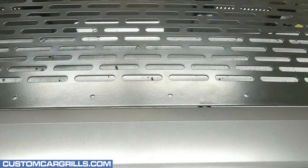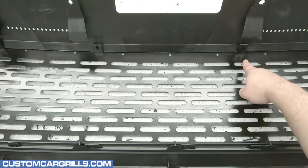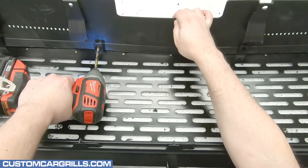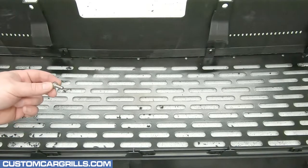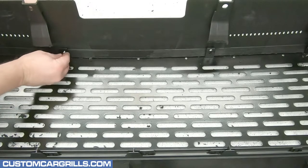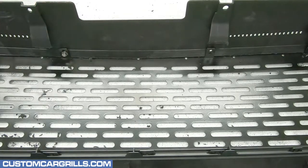Next, it's time to look at the gap on the lower edge, and this should be fairly tight. Then some drilling will need to be done so that I can drop in some bolts. A quarter inch drill bit will be the best size for the job. Use caution not to drill into the powder coated grille brackets. With the holes made, place the washer on the bolt and then feed it through the hole. Then place on another washer on the other side and thread on the nut to hold it in place.